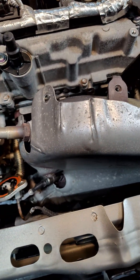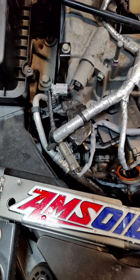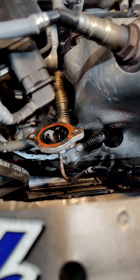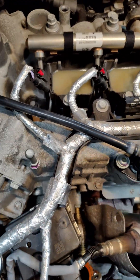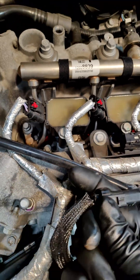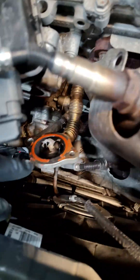I do apologize because I've already moved some stuff out of the way, but I'm going to walk you back through it. The main reason why you want to pull this is that one of the exhaust gas temperature probes is connected to this — just to get a little bit more slack. So you remove this, disconnect it: there's a quality assurance clip, you pull it back, press this down, and then pull it out from the connector.